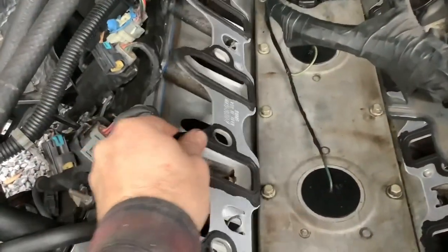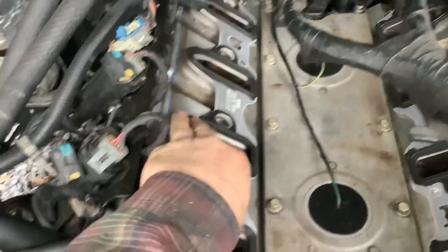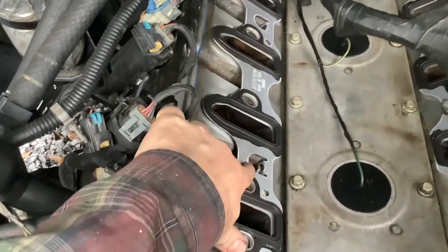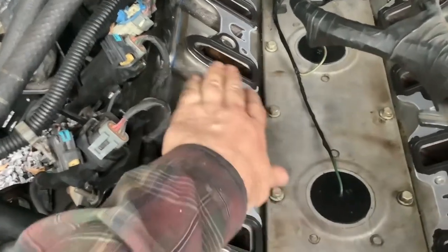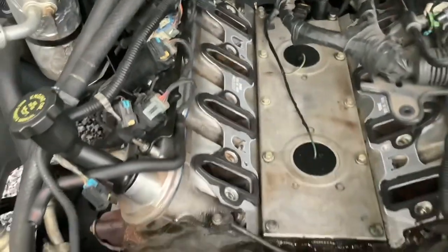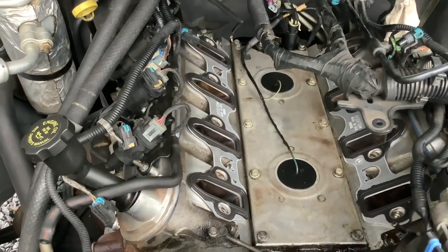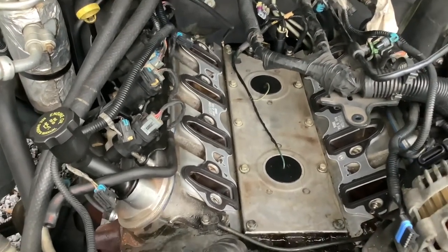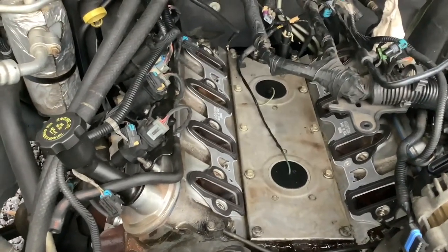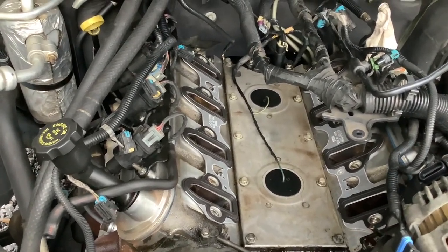These tangs go over the cylinder head bolts that are on the sides of the valley pan. The gasket simply loops over the top of the head bolts — you just place it in here and it drops right in over the bolts. I prefer that to having the gasket clamped to the intake and trying to make sure it doesn't fall off or get crossways as you're putting the intake in. So I'm glad these go ahead and sit on top of the heads.